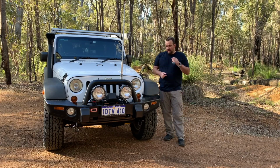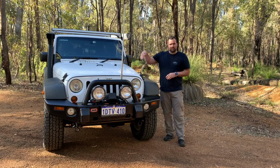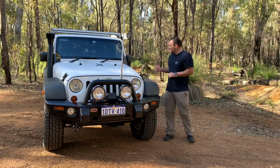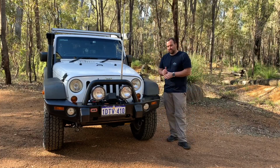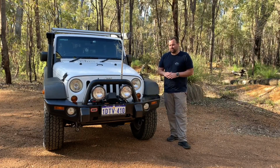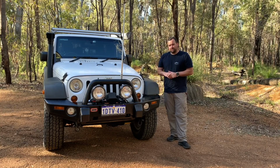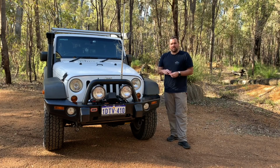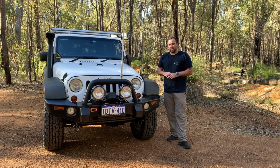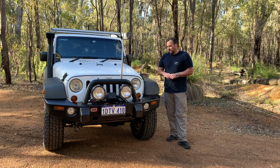It got to the point where, because I then put the winch into it, I got a little bit more sag at the front. And Jeeps often go around a little bit front end down, but it's so heavy now at the front. And at the rear, I've gone with what's called an adaptive load. So it's a load carrying capability of between 150 and 300 kilos at any one time. So I'm running at about, realistically, 150 with the drawers that are in there, as well as the fridge. And then that extra 150 kilos will help out for our future plans now, which will be towing. So the ball weight of the vehicle is being factored into that 150, and then we can go from there.